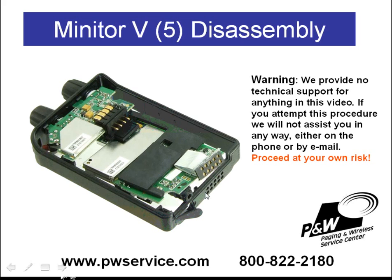The procedure is to simply pull on the plastic center housing — it'll deform the plastic out a little bit, and as it deforms you can pull the jack straight out. You're basically going to leave the knobs in place and rock the whole assembly up from the back or bottom of the pager. If you've pulled it out far enough, it should come straight out with a gentle pull. If you're having difficulty and pulling too hard, you've likely snagged it on the housing and need to be careful to avoid damaging something.